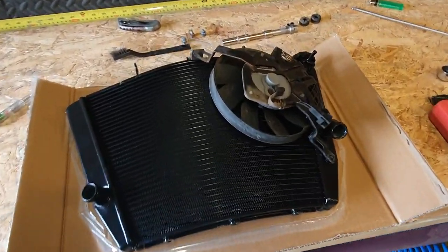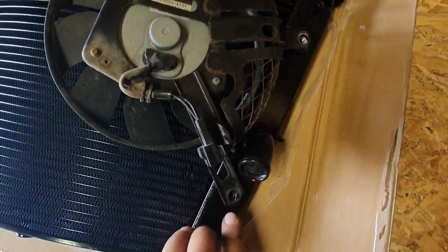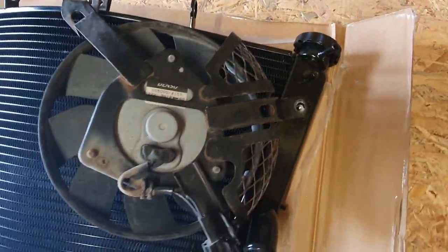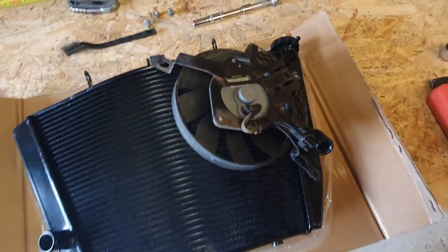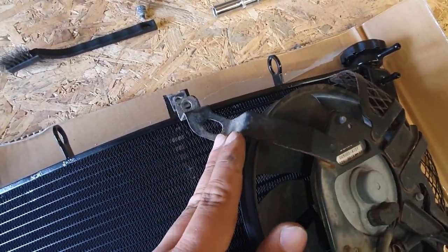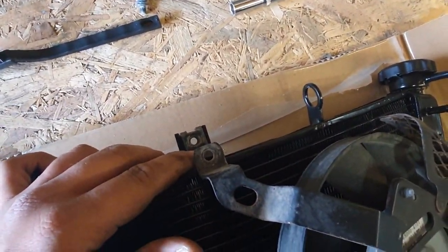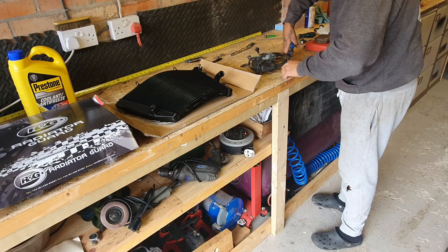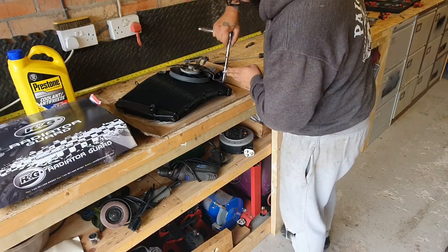Alright guys, so when it says in the description straight fit, it doesn't mean that it's always straight fit. As you can see in there, this bracket, or mounting hole, is aligned, so those two align quite well, but in there you can see there's quite a bit of a gap, which is usual on aftermarket parts. So in this situation, I'm just gonna unbend this bracket slightly and this bracket slightly, so that it will align with the hole and I'll be able to put the screw through. Using two sets of pliers, I was able to bend the brackets and make it fit perfectly. It's important to make sure the fan does not contact the radiator.